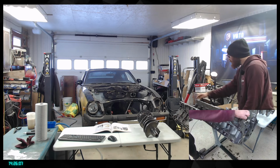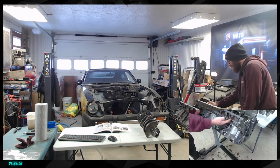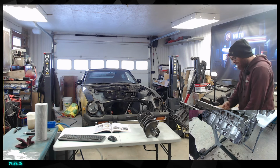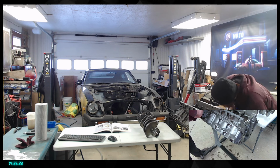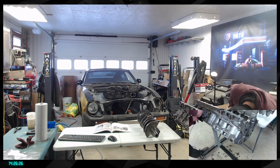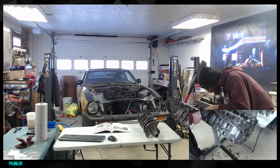That's probably where basically the oil is getting picked up by the oil pump at the front. Then it's getting pushed with pressure through here. It's moving up through the filter. Then it's going down through here and going around the engine to the other side. So that's pretty much how it's working from what I understand of it. So that's what we're going to take a look at and make sure that nothing is wrong with it.